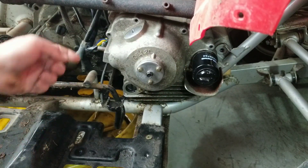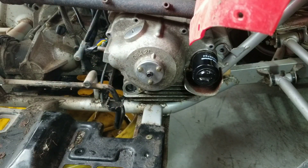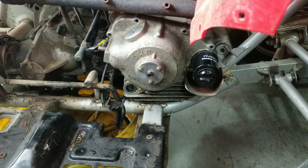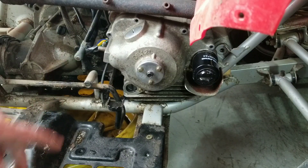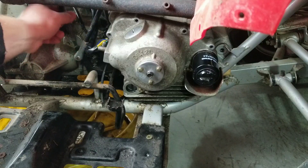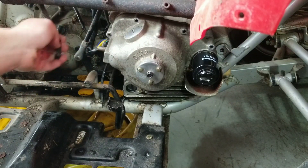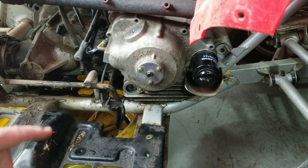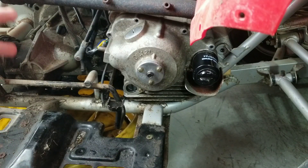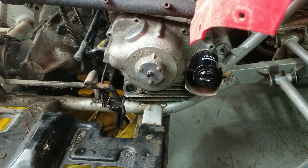It pushes in - it's not pushing in completely because that gasket stuck a little proud, but we should be okay. I'll pop this cap off and fill it up with oil after I put the bolts in. We'll reconnect this crankcase breather tube too. We've got to put our wedge back in down here to get clearance, put our front motor mount bolt back in, fill it up with oil, and we should be good to start it.